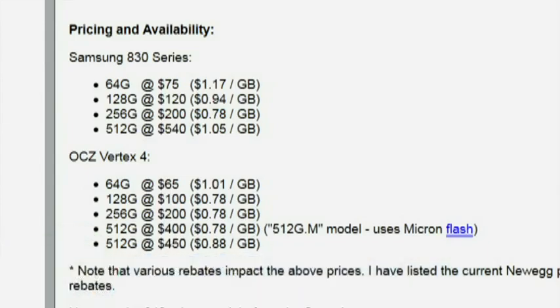The specs: sequential reads of 540 MB/s, sequential writes at 333 MB/s. For the 840 Pro, we're talking about 450 MB/s writes. Alan was, for the most part, impressed. He expects it to get down to about 80 cents per gigabyte once they scale it up. The pros: superb read performance, reduced cost per gigabyte compared to the 840 Pro, very low power consumption. The cons: relatively poor mixed read-write performance, and it only comes with a three-year warranty. MSRPs — 120GB is $110 for the basic version, $150 for the 840 Pro. 250GB is $200 versus $270 for the 840 Pro. 500GB — brace yourselves — $449 or $599.99 for the 840 Pro.